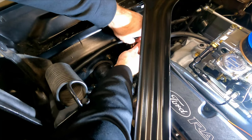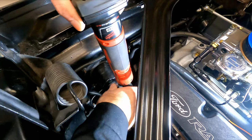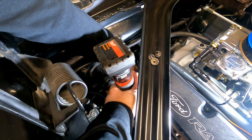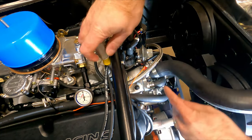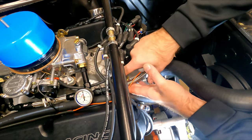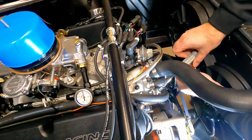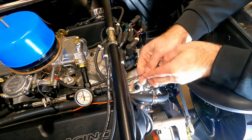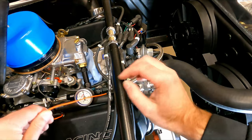We've got to disconnect the wiring for the heater fan motor. Then we're going to take off these seven-sixteenths nuts that hold this whole assembly into the firewall. While we're up here, let's go ahead and disconnect these hoses that go to the intake manifold and to the water pump. You might want to put some clamps on the end of these hoses so they don't leak anything — fold them over and clamp them so it doesn't leak any coolant, depending on how much coolant you got out of your motor.